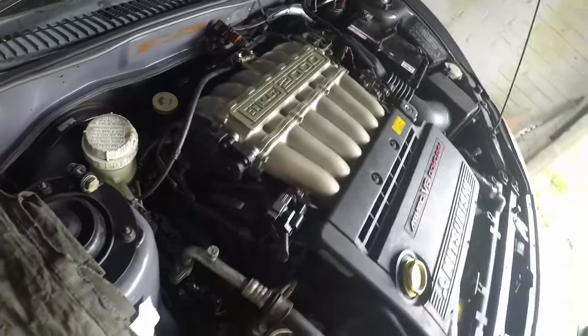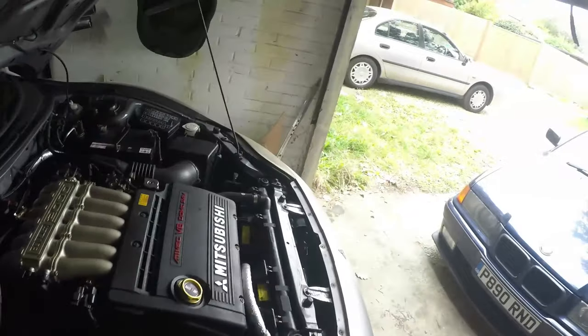Before I talk about final reassembly, let's have a little talk about timing belt tension. Timing belt tension on these cars is as critical as with any other car. Make the timing belt too tight and it's going to put premature wear on pulleys and the gears and the cams and so on. Make it too loose and you risk skipping a tooth. Neither situation is preferable, and thankfully Mitsubishi give you some clear instructions on how to do it,